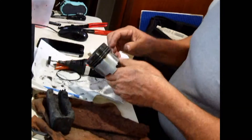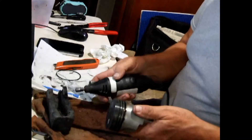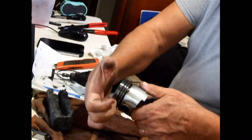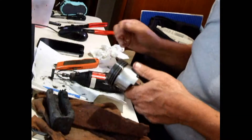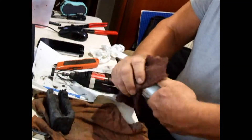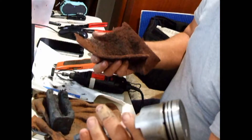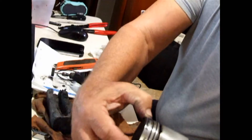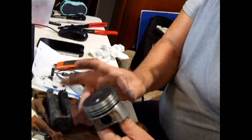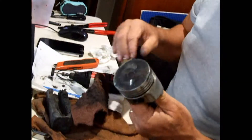After taking the rings off, I use my buffing wheel and some metal polish — instead of sandpaper or emery cloth — just to get the carbon off the sides of the pistons. Then I carefully clean out each of the ring grooves so the piston rings will work correctly. I prefer not to reuse these pistons, but I think they'll be okay — I measured them and we're still within spec. It takes almost a day per piston to really get them clean and ready to reuse.